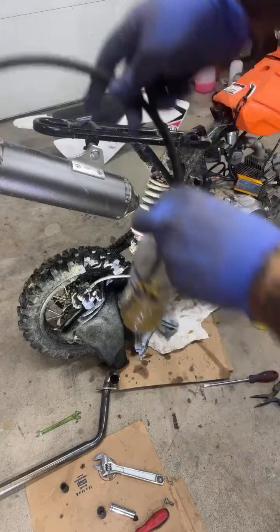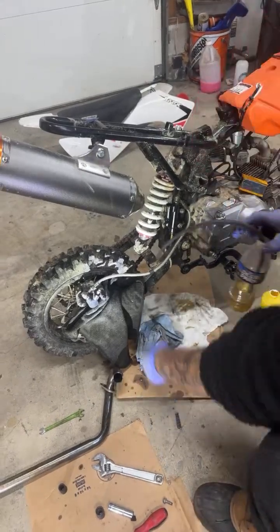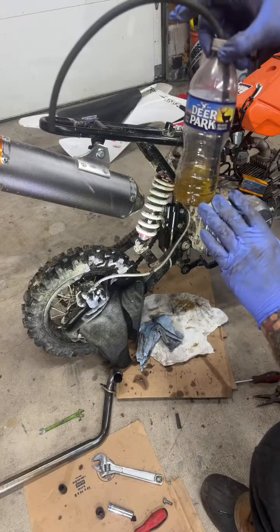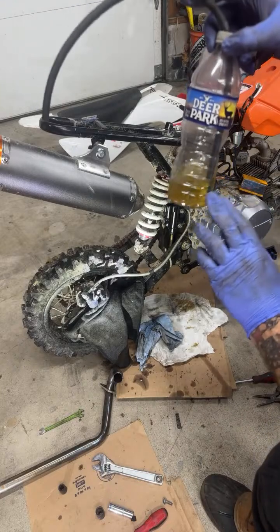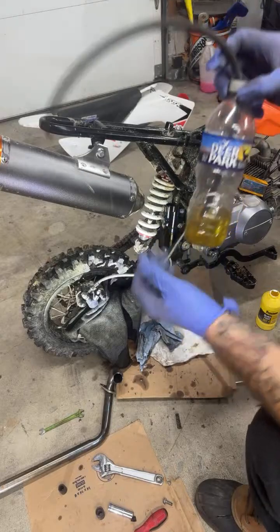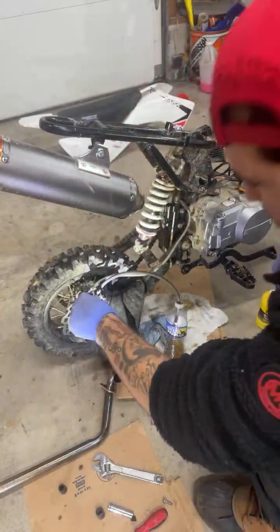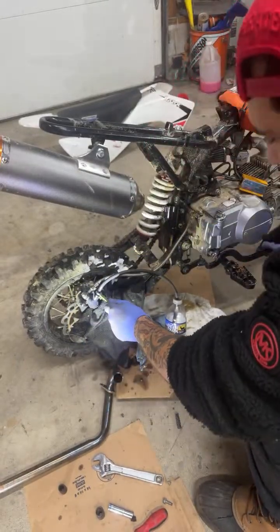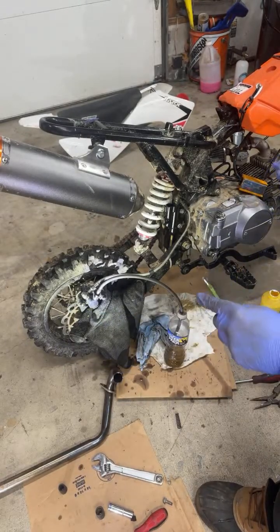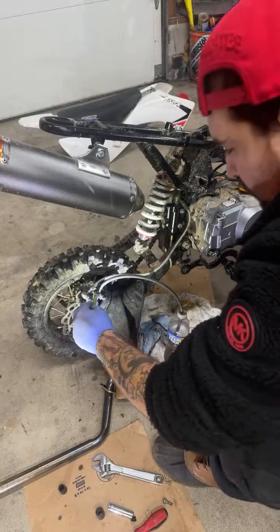So what we have is a self bleeder. Basically you need this. You have one end of the hose in a little bit of clean fluid. Since this is a new master, we're probably not going to see much dirty fluid through this since I already did this, but in a car, you're going to see this fill up with dirty fluid when you start to flush it. Anyway, so one end in the fluid, one end to your bleeder. Put it right on. Get our 8mm. Crack it loose. And then we're going to hit the brake, tighten it, and then let the brake go. I'm sorry, I'm getting tongue twisted. So you're going to loosen the valve, hit the brake, close the valve, let the brake go. If that makes sense. So open the valve.